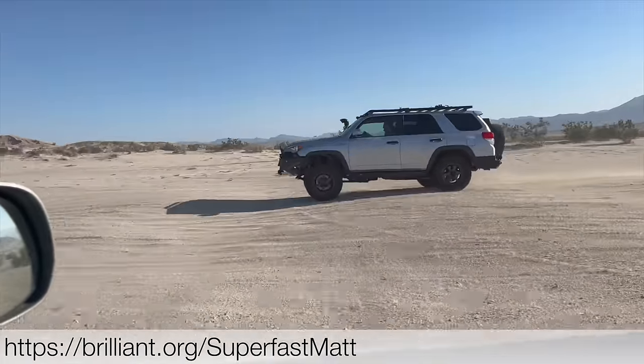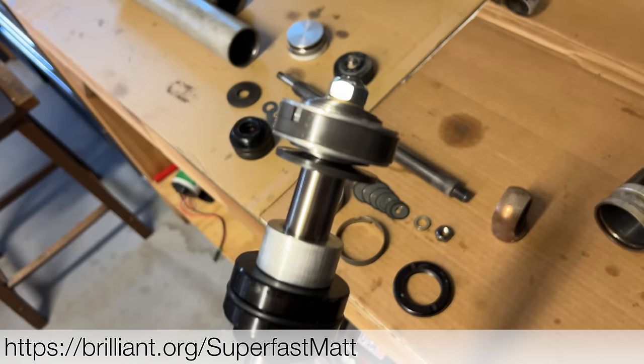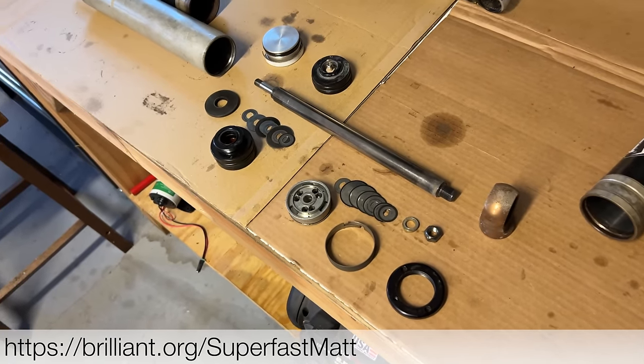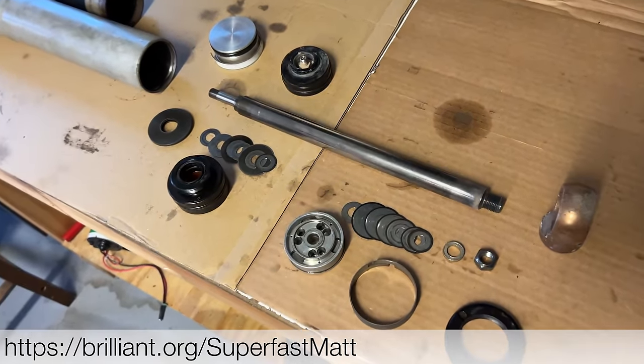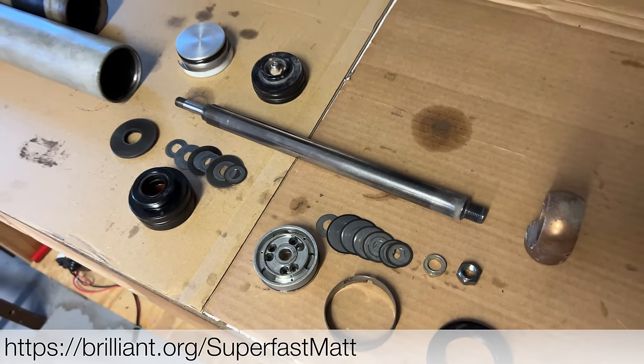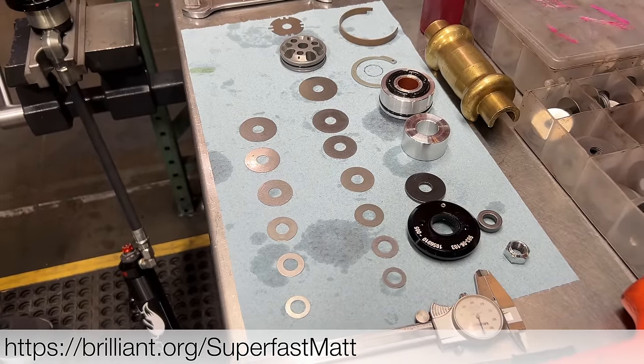interesting right now. While the world outside of an off-road coilover shock is chaotic and random, what's going on inside is pretty well known. All of these components follow predictable rules. The springs follow Hooke's law. The pressure applied by the nitrogen to the piston results in a force at the shaft. Learning what everything does in a shock is fun, but learning why and how all of these things react the way they do is what allows you to make it better and allows you to make it right for your application.